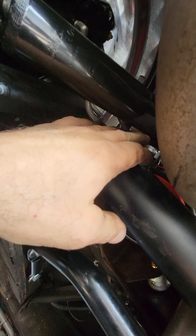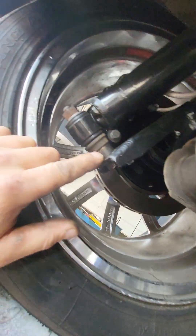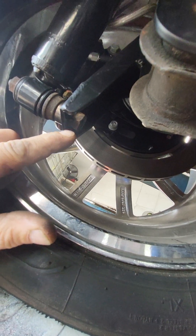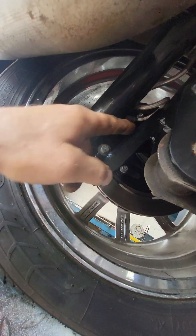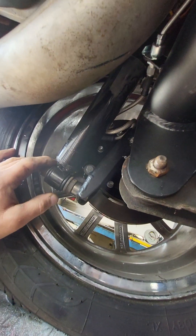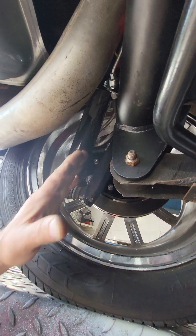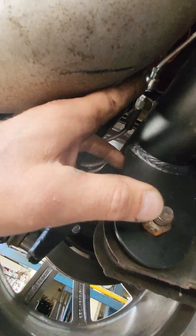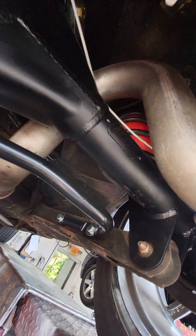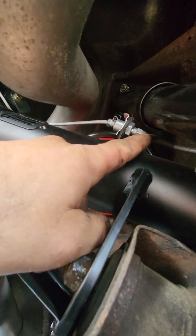I had to bend this bracket to get it to go in further. This is the spacer I had made up — we're running out of thread here, it really needed to be back another half inch, or these brackets needed to be heated up and tweaked, which I'm not going to do. Now the shock geometry is a lot better to clear the stainless steel line and tube nut. On the other side, same thing — just push the brake line back and tweak it so when the shock compresses it will clear the line.